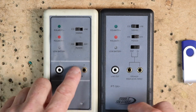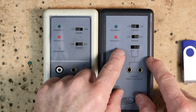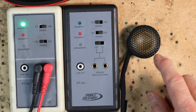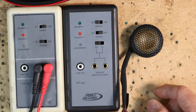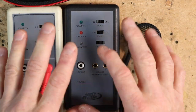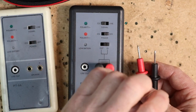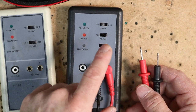This third switch is what separates this and makes it the ultimate polarity test tool — it has an input and an output. The output works the same as the older tool: connect test leads to it and it'll make a popping sound from the speaker, which you can read with the microphone tip to know if you've grabbed the right positive and negative. On input, I can now test the output of my signal source — radio, amplifier, anything like that — even if I don't have a speaker. Let's hop into the car and do some testing.